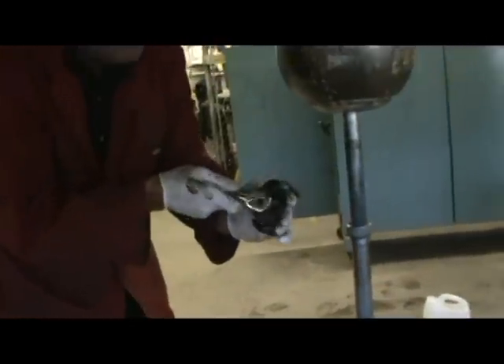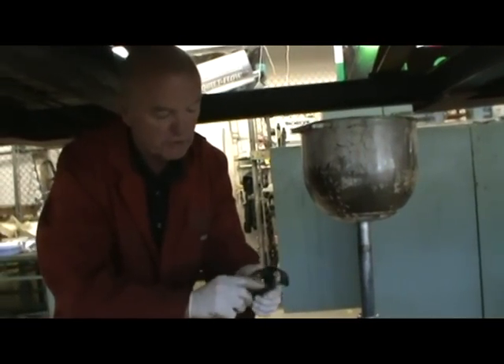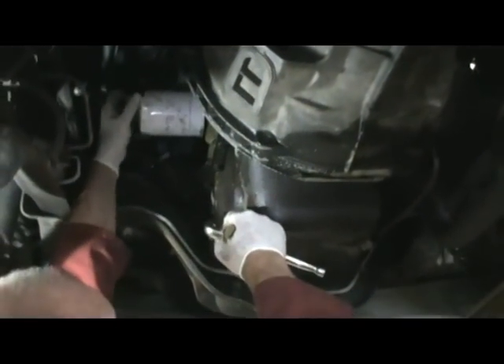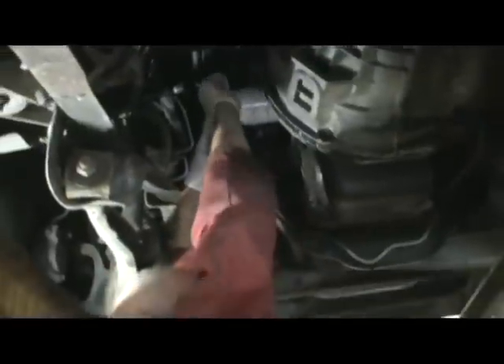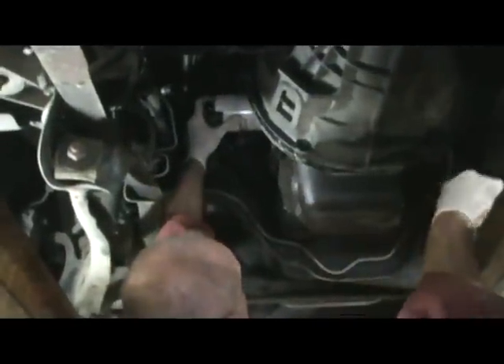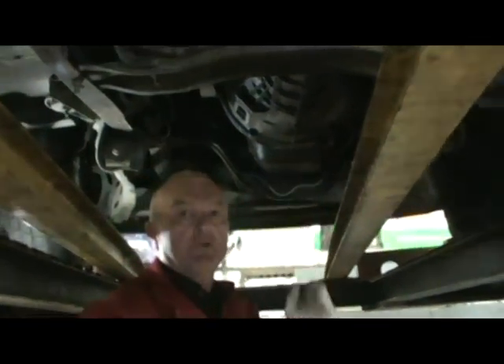I find it a little bit too tight, so I've selected an oil removing tool that will tighten only when you're turning counterclockwise for removal. If you try to tighten a filter with it, it won't do it — it just expands out of the way. I'm going to put this on the filter and use a three-eighths ratchet. I've got the filter loose but not yet leaking. I'm going to put the oil container underneath it, raise it up a little bit, and remove the filter. Watch you don't get oil on your clothes.